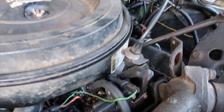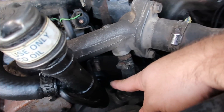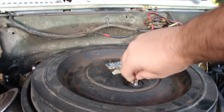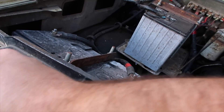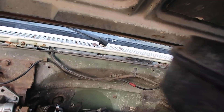This is what we're trying to get off right here — the injection pump right there. So I'm going to pull this bad boy off. We want to gain access in here. You can tell it's been worked on before. The previous owner said he took the — let's put this off, pull this bad boy off. Before we start, I'm going to disconnect the batteries here shortly. I'm going to go ahead and loosen up all the bolts to the intake manifold and get that thing lifted off.